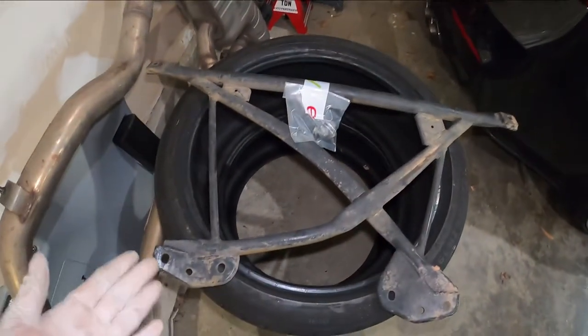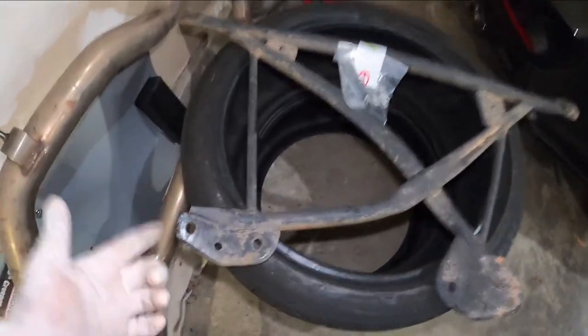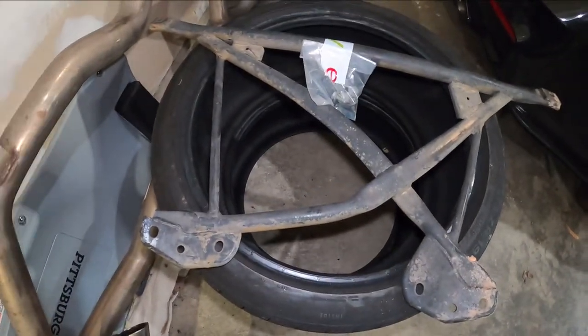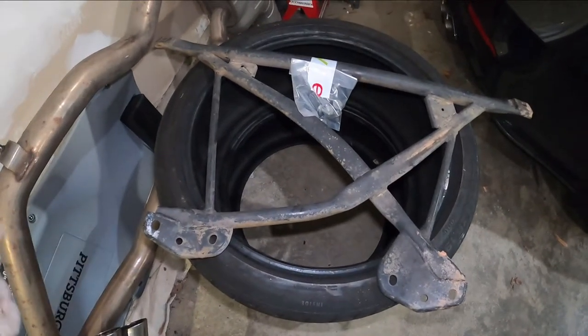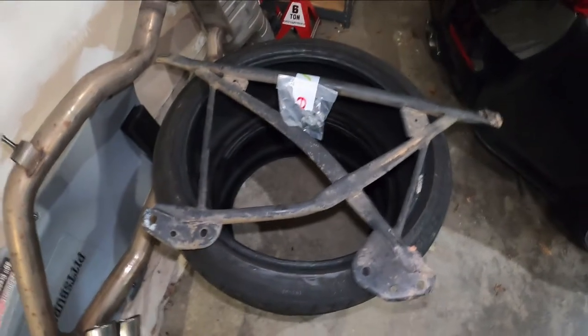Because I have a '98, I don't have to do any of that. When I'm under the car I'm going to show you exactly the holes I'm talking about. This x-brace piece can actually be found in a Z3 M, the lightweight version of the E36 M3, and also on a convertible. They use it because it helps a lot in terms of handling. So let's go ahead and mount it on the car.